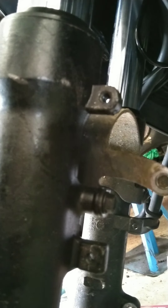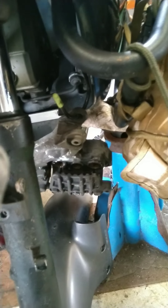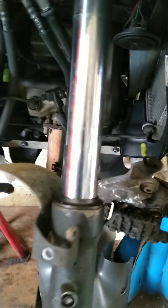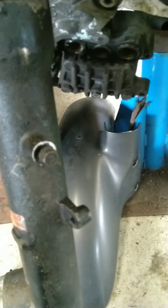As you can see with this mudguard, just take the mudguard mounting bracket off before you even start to try to remove the fork, because as you can see — stupidly — it's just not gonna come out with one bolt still in. So make sure you take it off. As you can see, I'm struggling a bit there. Once it's off, everything's a lot easier. Just to keep the bolts handy, I've put them back in the fork so I don't lose them.